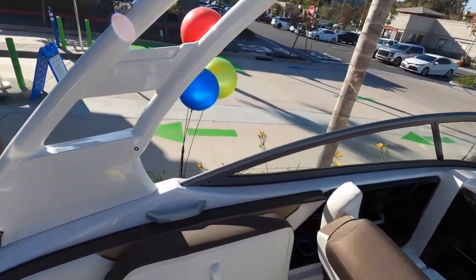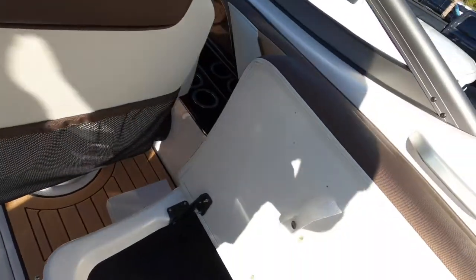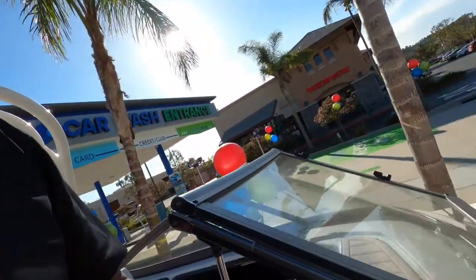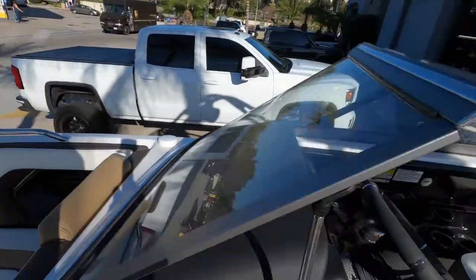The speakers are here — one on each side — and we had to make those cutouts larger. The nice thing on this boat is those particular speaker housings were plastic, so when we cut them we found it was all plastic. We also did speakers in the bow — the front. All the speakers illuminate, so we had to run brand new wires from each speaker set plus wiring for the lighting — a minimum of four wires each. I didn't find that out until after I ran the wire, so I had to redo a lot of the wiring.